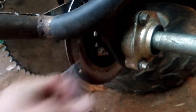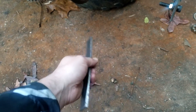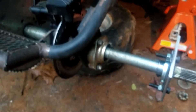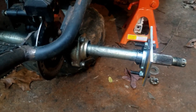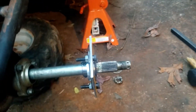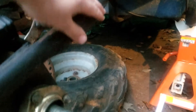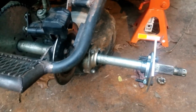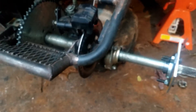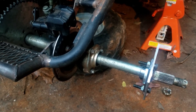I've already pre-cut these pieces, so I'm going to be welding one here and one right there across the bottom — that's going to make up the rear part of the reinforcement. For the forward part, I'm thinking about running a bar from here to here. As for the bottom, I'm still in the staring and think phase on that — I may have to build a piece that comes down and weld to it. Right now we're focused on getting these pieces welded, so let me prep the steel and get it ready.